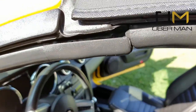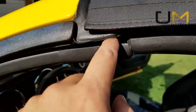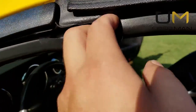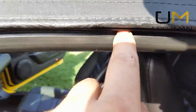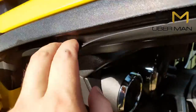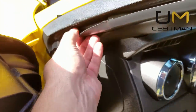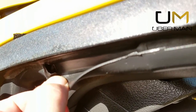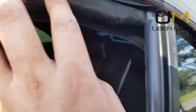When I just cleaned this one there was a lot of debris — and you guys may not know this — all through all of these. There's a reason these have lips: rain and moisture run through channels, they run down, and it actually channels it inside where it drains out underneath the car. You want to make sure there's a hole in there — that's where the rainwater goes through. You've got to make sure these are kept clean and all the channels are completely clear so that water drains properly out from under the car.